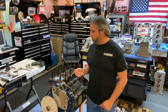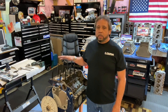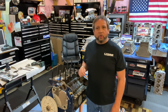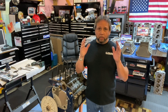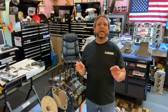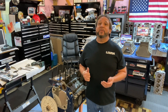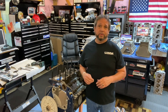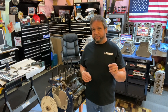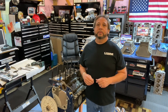Now what I'm going to do is measure this loaded — put it together with the actual valve spring setup I'm going to use, tighten it down, rotate it over, and measure the piston-to-valve clearance with the loaded method. You're going to get the most piston-to-valve clearance utilizing this. The whole point of this video series is that you might get more cam than you think in an engine if you measure using the loaded method. That's what a lot of fast guys are doing — the super stock racers at least. Rohde told me that way back in the day, and Darren Morgan confirmed it too.